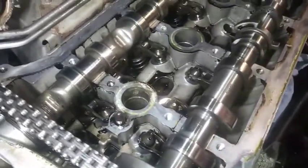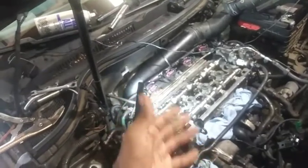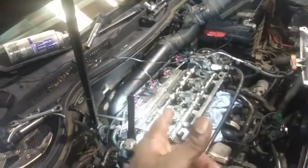What I'm going to do is leave the old oil in there, drive it around, and hopefully let whatever debris is in there get broken up and circulate into the old oil filter, then I'll re-change the oil with new oil and filter. That's the best decision I can make right now to keep the engine clean. If that stuff is designed to be in the motor at a liquid state, I can't imagine that little debris actually causing harm once broken off and getting into the oil channels.